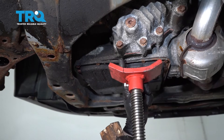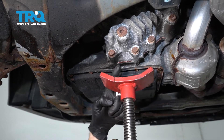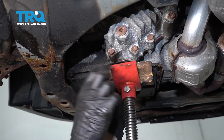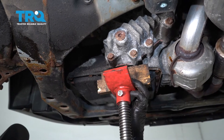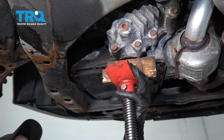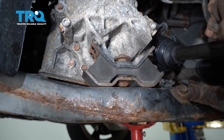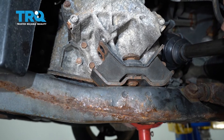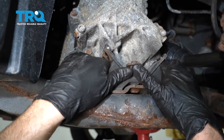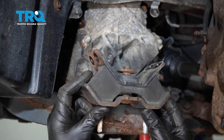The next thing we're going to want to do is put a block of wood coming across this area right here. I want to be very careful not to get it on the transmission pan or on this area right there, because we don't want to go ahead and damage any seals. Just go ahead and slide that right in there. Now we're just going to carefully lift this up and you're going to be able to see the transmission start lifting up and away from that area. We only want to go as far up as we need to — we don't need to break anything. Just go a little bit higher, slide that right out. There it is, friends.